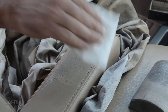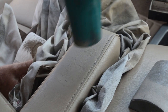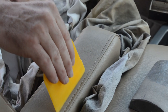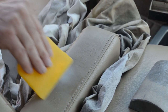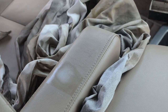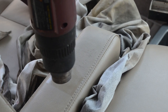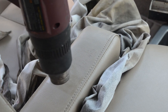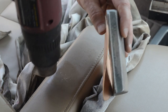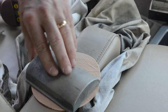When using the ironing method, sometimes you'll have a halo effect around your repair, or you might see that the vinyl has welted — like if you get a burn on your skin where it raises up. The answer to that is to come with a thin layer of compound and use the heat gun method. Now we're using the medium vinyl repair compound that we regularly use, since it will feather much better than that compound with the fiber. Use the heat gun without a reducer tip — we want a wide heat application. We want to go from the repair all the way to the original vinyl and get a nice transition, with the grain we want on the bottom. Then put the chill bar on top and get that nice and flat.